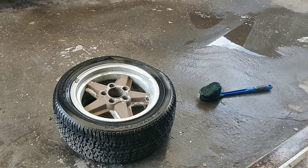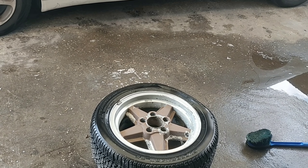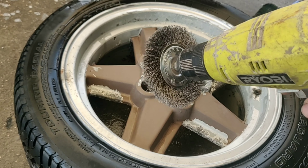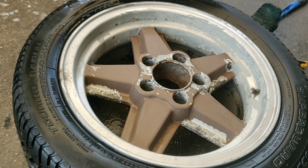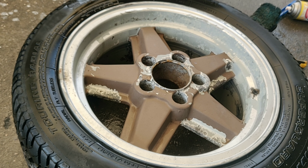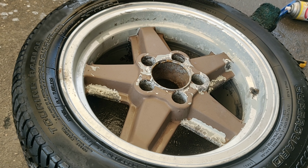So back to this one — I'm going to start using the wire wheel grinder to get off any of the bad areas, then move over to the vibrating sander, and then go to hand sanding. If your rims are not as bad as these, you can definitely step right into wet sanding or a vibrating sander depending on how bad the curb rash is. Removing the valve and weight is really only necessary if you're doing a full tire change-out; it allows you to do all this work and paint it without worrying about damaging the tires. Make sure you wear goggles and a mask when using the wire wheel or any device that throws dust or debris in the air.